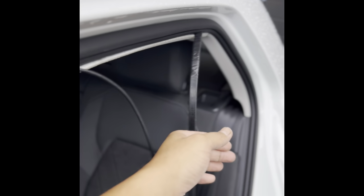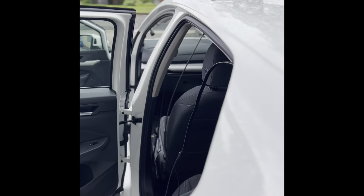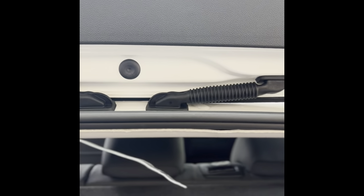We pull the roof lining down here on the side, and as we get it we get it to the back trim, pulling down the roof lining carefully. As you can see, the cables are there — we have a long cable tie that gets to the back of the car. We pop the roof lining down — there are two metal clips, one and the other one just behind my cable tie. We route the cable through and continue at the back to get the camera here, go through the grommet, remove the plastic trim, mount the camera, and loom up the extra access cable.